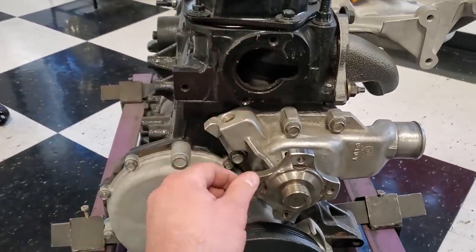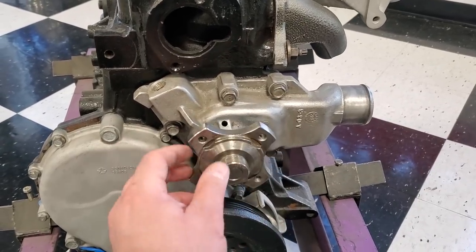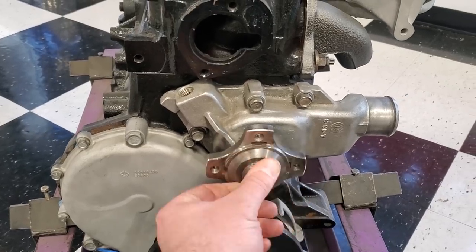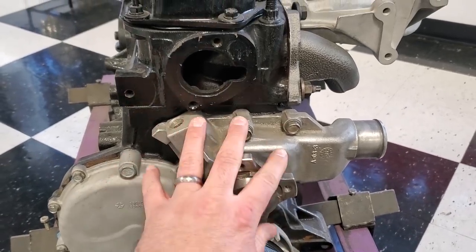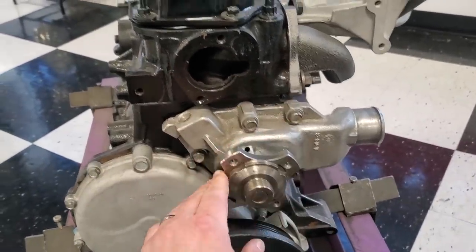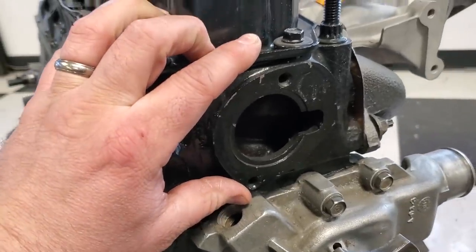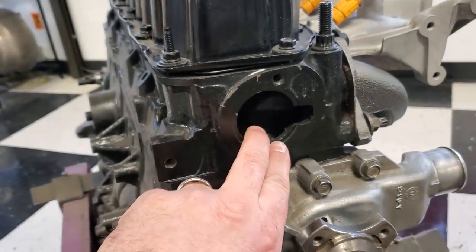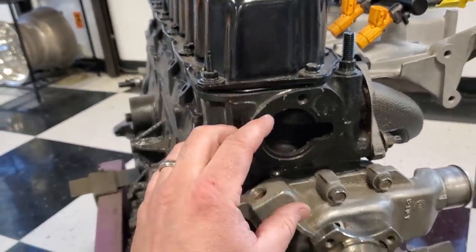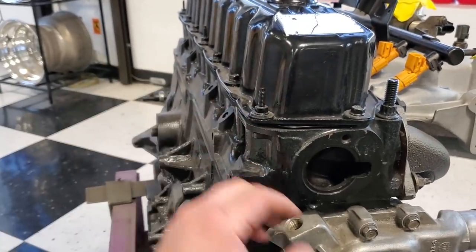And right here, you can tell by the water pump, it is a dead giveaway. Now, right here, this little impeller, this drive thing, it's threaded for the fan, like the TJs, WJs. It's also sticking straight out to the side at the 3 o'clock position. Oh man, I am so bummed out. It looks so similar. Even the thermostat housing from the front is similar. It takes the same power steering pump. All up in here is similar.